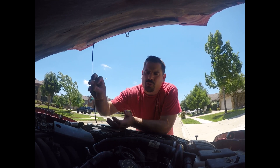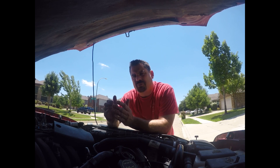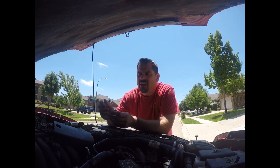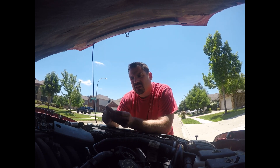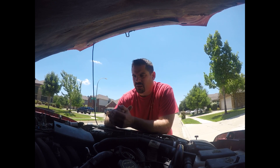In these instructions, I still didn't use the alignment tool. I actually own one but couldn't find it. What really matters is that when you install the cam sync, the tab is right in the middle of that gap — that's what tells the computer when the car is at top dead center. The instructions also tell you to put it at roughly a 25-degree angle off the engine, but the direction doesn't really matter. It just matters that the engine is at top dead center on that sensor. It doesn't matter where the actual sensor is pointing in the back.